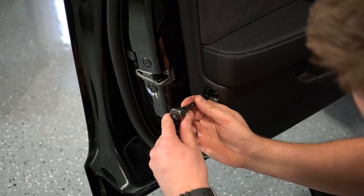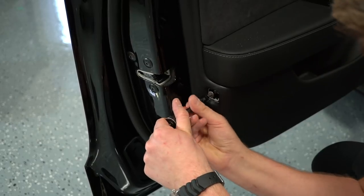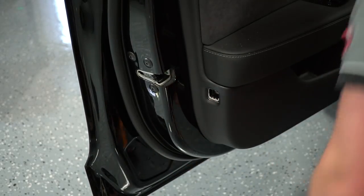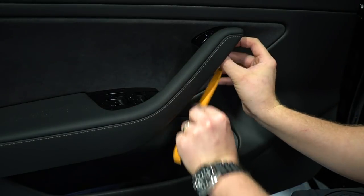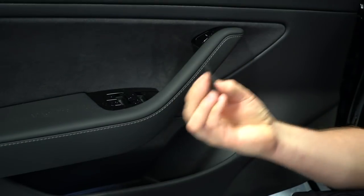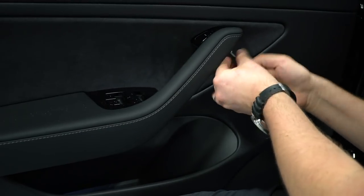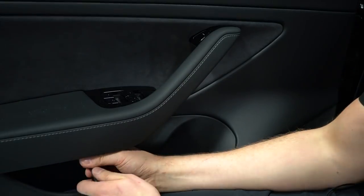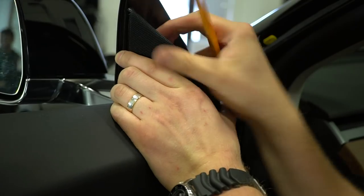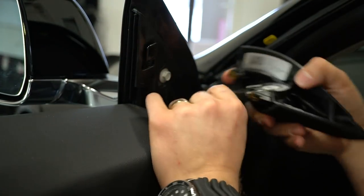To remove the panel it's gonna be very simple. There's one bolt hidden behind the reflector — just pop it out with a plastic pry tool. Try not to use any metal screwdrivers as there's risk of damaging the reflector or the panel. There are two more bolts hidden by the pull handle of the door — one is behind a small clip on the top end, so we need to remove the little plastic covering to access it. The other one is underneath the light switches. We'll also just remove the tweeter — push it up, use a plastic pry tool, twist it a little bit, and it slides right up.